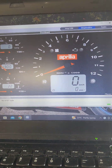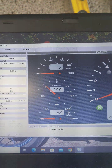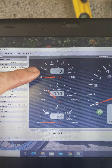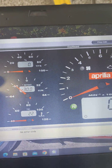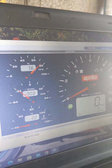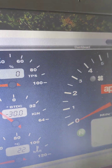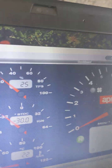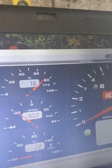And mysteriously it's turned to Aprilia. So what I wanted to test for a gentleman on one of the forums was my TPS, which is here. If we twist the throttle, it should be on zero if it's shut — which it is. Twisting flat out, it should go to around 80 or 79 — there we go, 76. And that's meant to be normal.